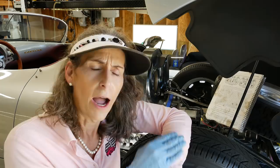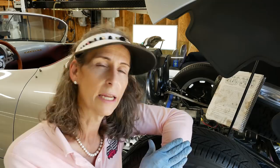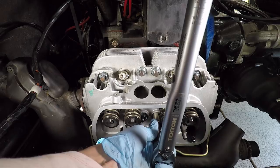So what that means is that they're going to get a lot of pull on them when the engine gets hot. Now, I've heard somebody said that it's the equivalent of 70 pound-feet when the engine is hot, and if you torque these things down too much when the engine heats up, it'll literally pull those studs right out of the case. So the torque spec is very important on this. It's absolutely critical. So don't go above it or you risk pulling your studs right out.